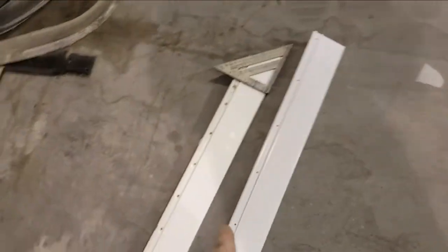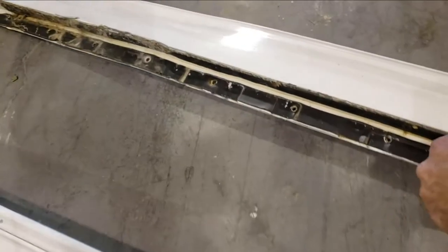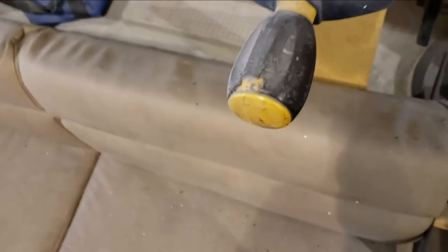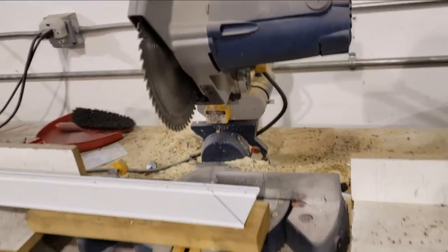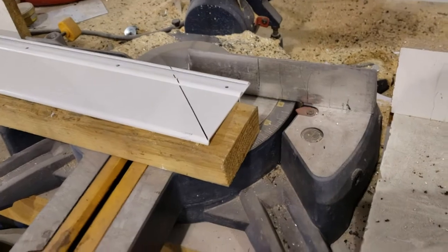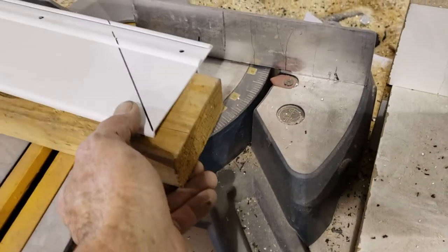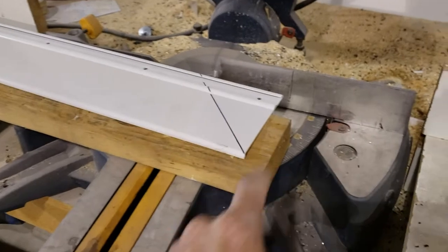On the slide-out fascia, I didn't originally plan on replacing the rear panel, but because they sent me an extra one anyway — and since I paid for it — I took it off and noticed it had actually been broken before. Seems as good an opportunity as ever to make it match the other one. This is just a 45-degree cut — I'm going to cut that 45 first and then cut it to length afterwards. Cutting aluminum is hard on the blade, but this isn't that important of a blade anyway. I'll be able to do this a lot easier on the miter box than trying to do it by hand. Watch your hands, put eye protection on, and I have a piece of wood under there so it's not rocking — I don't want to mar up the important side.